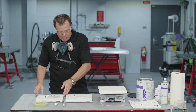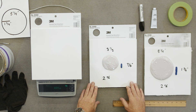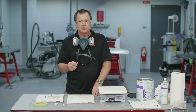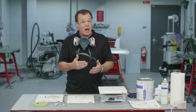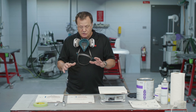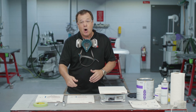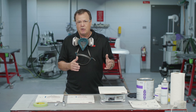I mixed up some previous amounts and as you can see, for this amount of body filler when put on a scale — about a three and a half inch puddle — 2% works out to about a seven-eighths inch bead of hardener. Keep in mind this will vary by the product you're using. Some fillers will make a larger or smaller puddle depending on their thickness. It's all relative to the products you use, the way you mix your filler, and even how you dispense the hardener — you might squeeze out a fatter or skinnier bead.